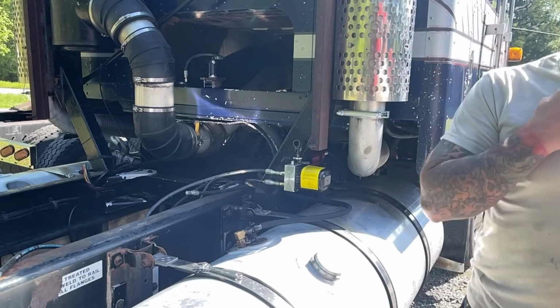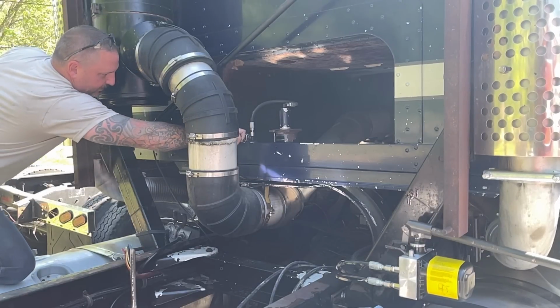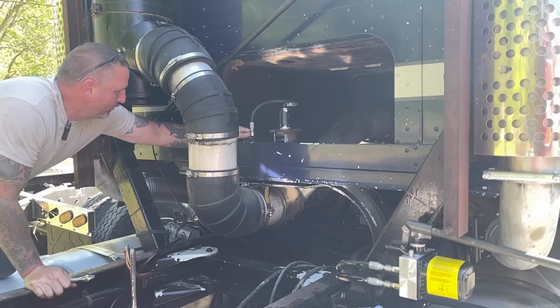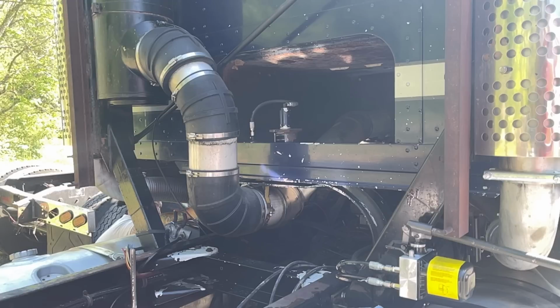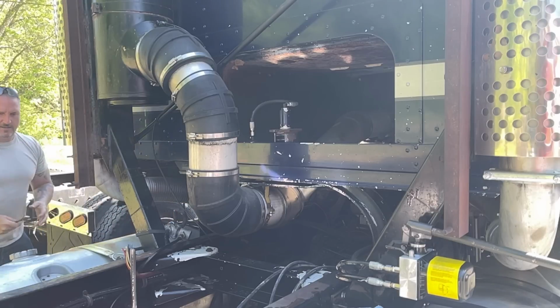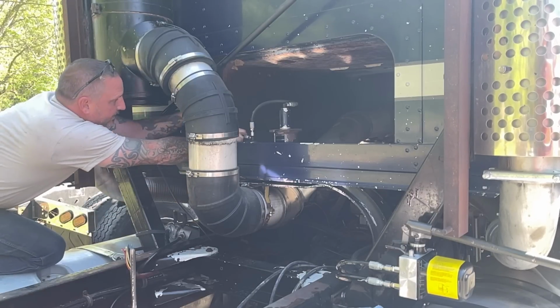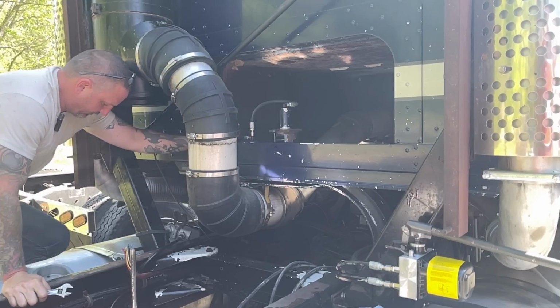Okay, I'm going to need a handle. I'll be right back. All right, so one thing I need to do is I've got this hydraulic line and it kind of goes under the exhaust. So I'm going to reroute this right quick. We just did a temporary hookup before, and so pull this out and we'll go over the exhaust. That way the cab can go up, and then we'll get this thing in the straps and holders where it belongs. But for right now, we're just going to test this pump.